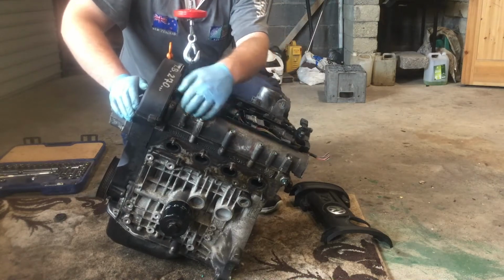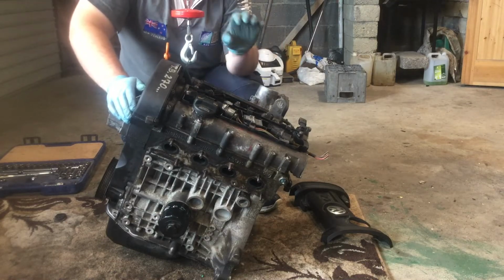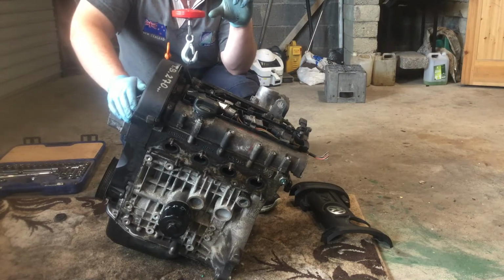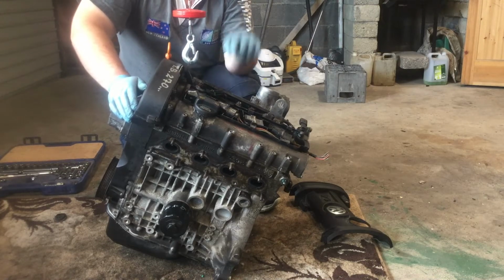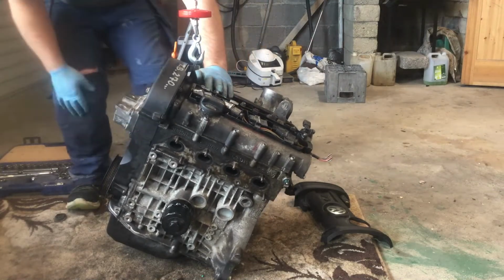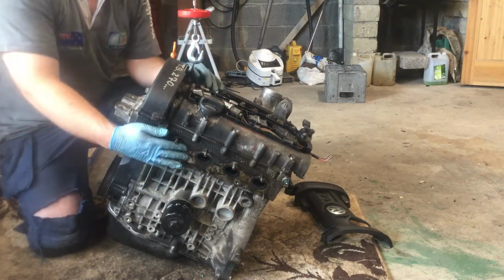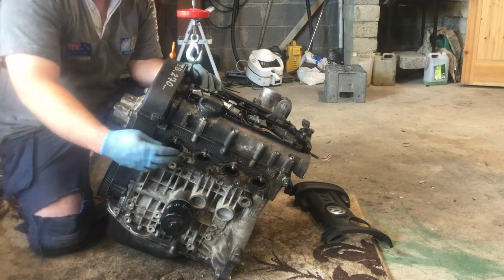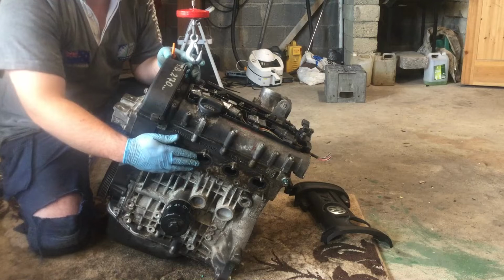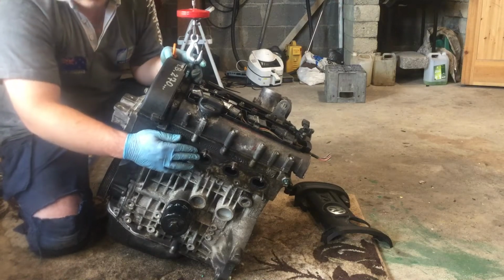This steel cover, or this aluminium cover here, is what's called a rocker cover, and that covers what's called rockers that push down on little components, little bars that are valves that allow the air in and out of the engine, which we'll look at in a further video. Down below the rocker cover, so you can see this seam here, we have the head. So this is the cylinder head, and this covers the entire engine, and this is what basically keeps in the compression, keeps the force, manages the airflow and the fuel injection.